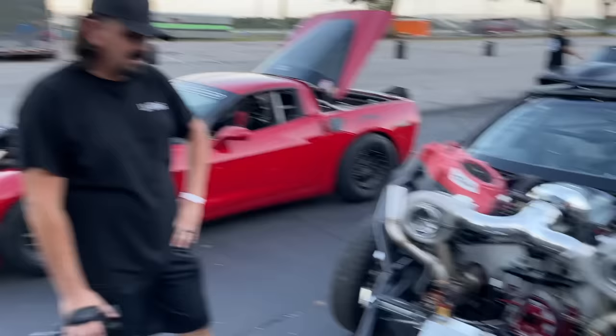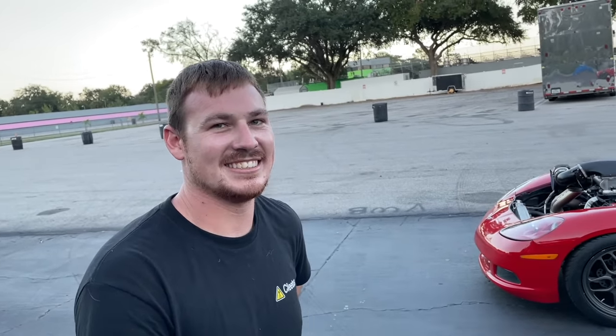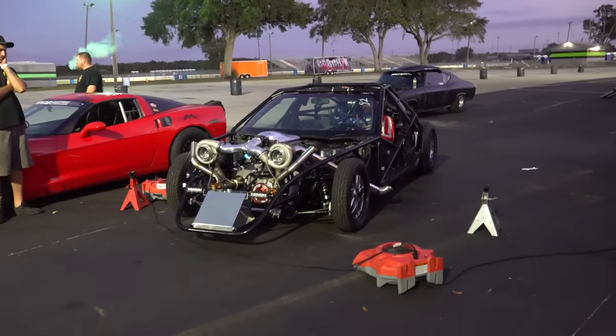Okay, go from 24 grams, which is what we have on the clutch now, to 30 grams of weight, and throw as much boost at it as we feel necessary. I like where this is going. He's like, 119 is pretty slow. This is our first slow run. I know. So time to throw some weights on this thing. Let's do it.